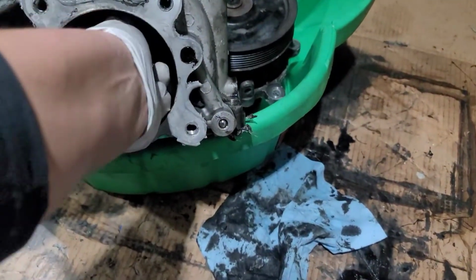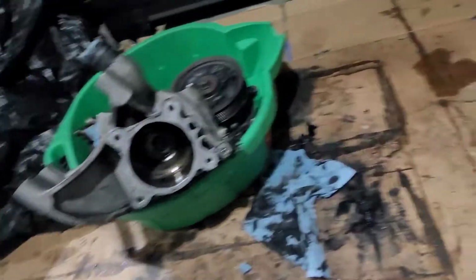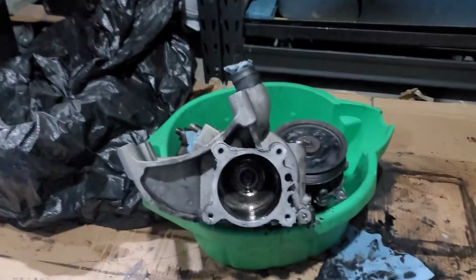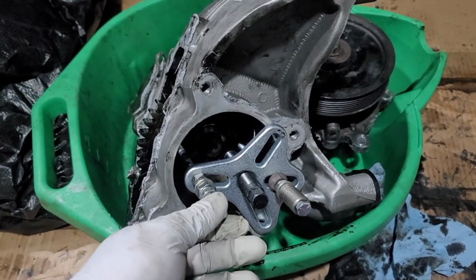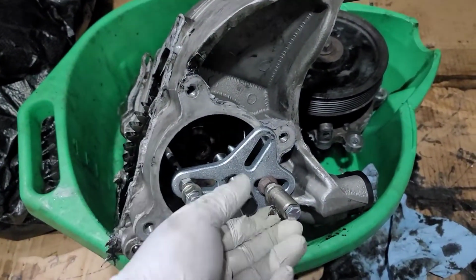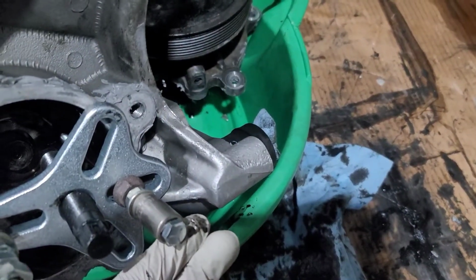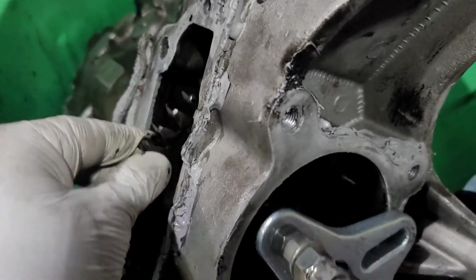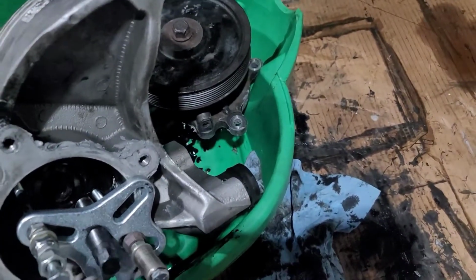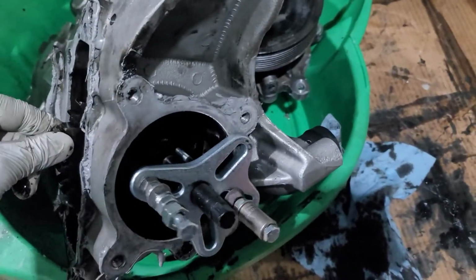It's a bolt, it's got a washer. Make sure you get those out. Don't drop it. Don't lose it. Set it up. Okay, guys. After you set this in place to your drive gear centerpiece, this is a 14. And here I just use old nuts that I have for spacers, just to give you an idea of stuff you could use so you don't use 50,000 washers. And that's all you need right there. So now take these off, take this off, and your gear is loose. So once you separate your fuel pump from the housing, your gear drive will come off.